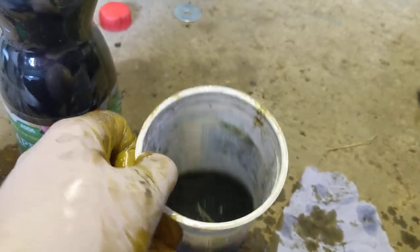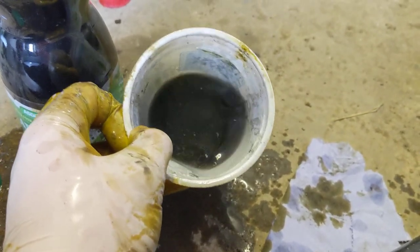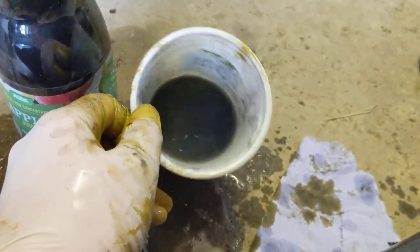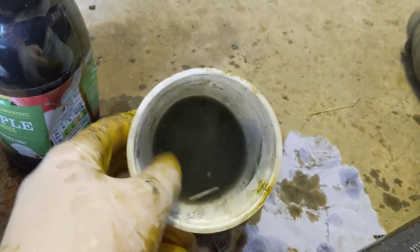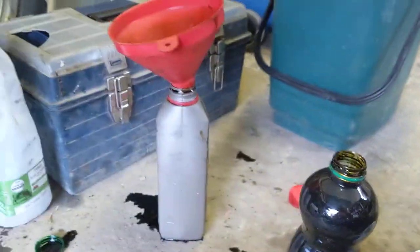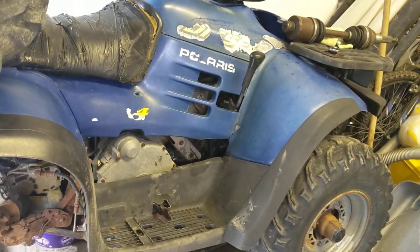I'm not sure whether it's a blown head gasket or not. The water is definitely discoloured. The only thing I thought this could potentially be is diesel exhaust — it could be a very minor fracture in the head gasket causing some diesel exhaust to pressurize the system. Diesel exhaust is sooty which could lead to this sort of black discoloured water. I can't decide whether to just pull it apart and do the head gasket — leave a comment with what you think.